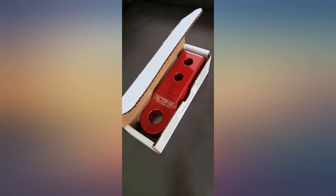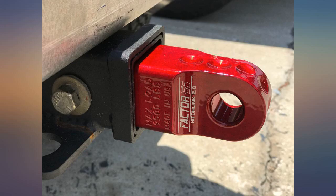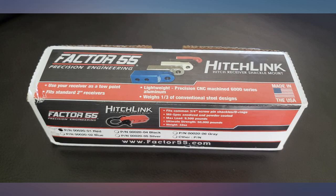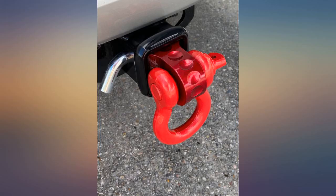Beauty — carefully engineered, smart, functional, durable. Can use with soft shackles without damage. The only safe way to connect a towing vehicle using a 2-inch receiver for a snatch recovery. Never use a tow ball as a pulling anchor.